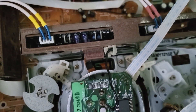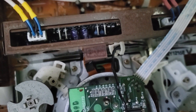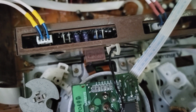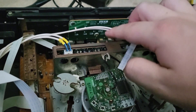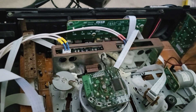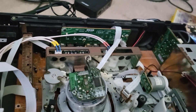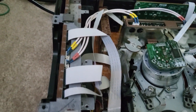These wires — the little ribbon cable going into that green socket into the main board — that's where the VHS playback stuff goes. The one going to this board here is the digital preamp board, so that's where your D-VHS and D-Theater stuff goes through. They're sent here to the digital board, where all the magic happens.